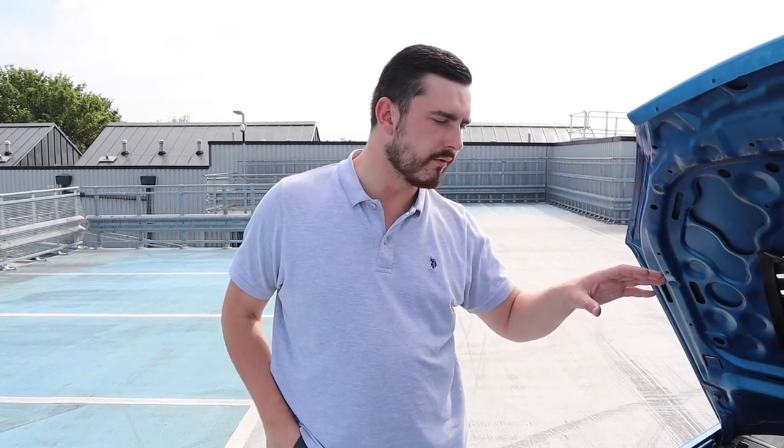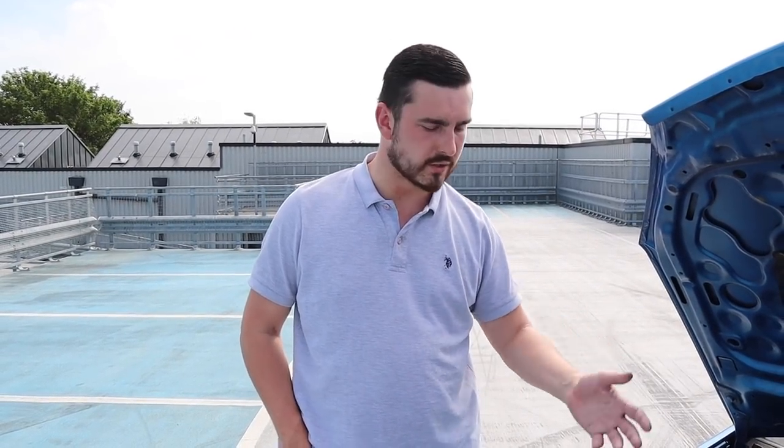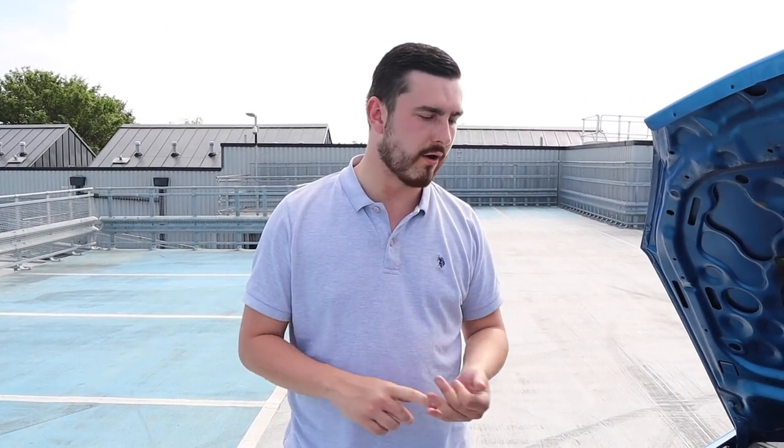We've also got an EDS replica inlet, MTC intercooler, all your normal stuff, 1000cc injectors, 90mm MAF. Boost gauges so I can see boost, oil temp, water temp, oil pressure, and my AFR, just to make sure everything's running okay while I'm either driving normally or giving it a bit of depth. And that's sort of an overall spec.